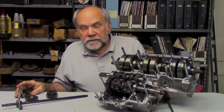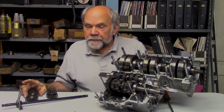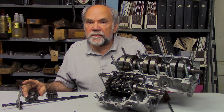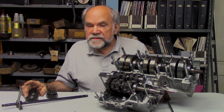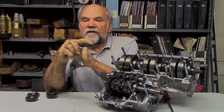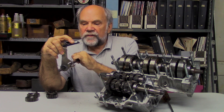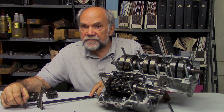Not that you'd want to do anything about it. Most of the problems with poor shifting are traceable to causes that are outside the engine. It's quite common for people, in attempting to adjust the height of the shift pedal to suit their ankles, to get the linkage in such a state that it cramps against itself when you make the shift and doesn't push the shift claw far enough to engage the gear fully. So if you have a shifting problem, look for the problem in the external linkage first, especially if you've recently made a change.